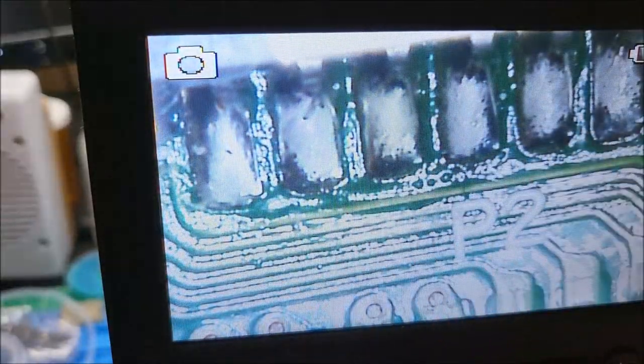I'm not going to desolder all the connections in the back. We're looking at all these connections — if we wanted to remove the cart slot completely, we would do that. But I'm going to try to just lift this metal can so I can see underneath from above and see if I can poke those pins straight and get them realigned. Then I wouldn't need to replace the entire cart slot. If I can't do that, I'll need to buy a replacement cart slot — desolder this one using hot air or just snip it off if it's not worth salvaging.